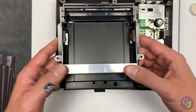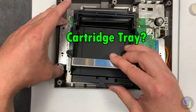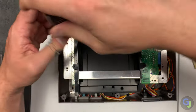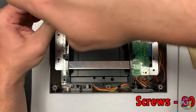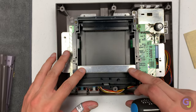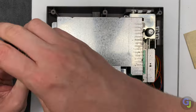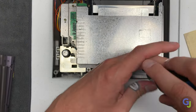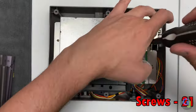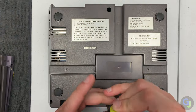One quick tip: when you screw in the carriage — the big black part that goes up and down — if that's too tight, it can get stuck in position. Just put these screws in snugly but not fully tightened down and this won't happen. Once it's all put back together, you're good to go for years to come. Now it's just the pain of putting all 21 screws in again. Just remember that there are two larger ones for the black carriage, but all the rest are the same, so at least that makes it easy.